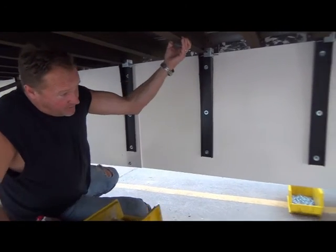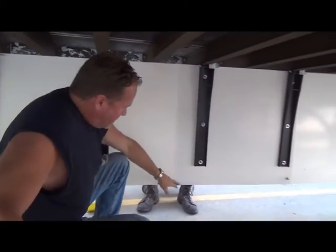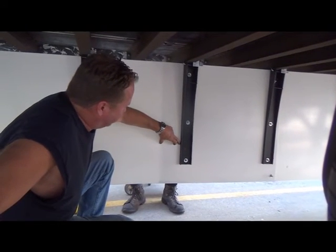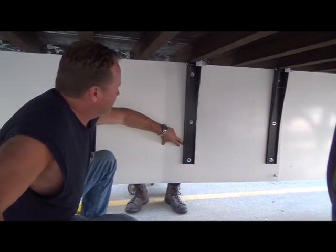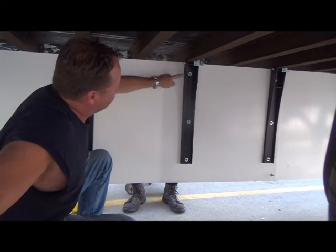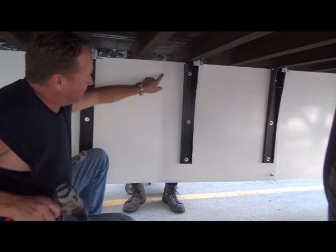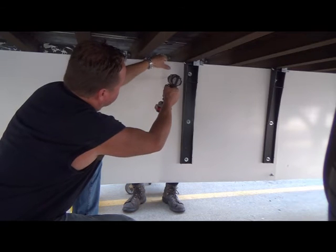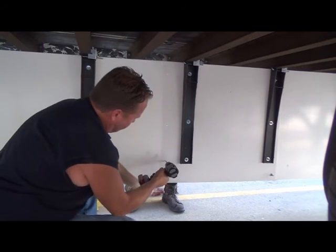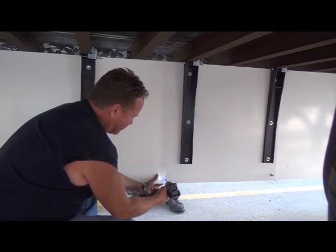Down here, you'll see the next overlap. Right here, you can see a slight shadow. It isn't quite on the stanchion. I usually use 4 or 5 inches as a rule of thumb. You're going to want to put an extra set of fasteners on this seam right here, which is on the outside visually. So we're going to follow the same place. One hole here, another hole here, and another hole here. And then obviously on the bottom where it's connected.